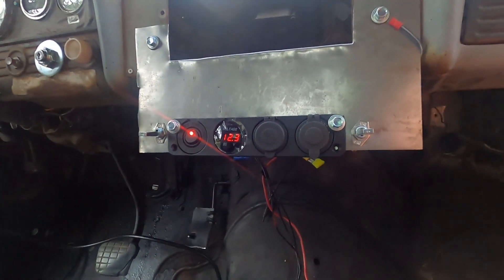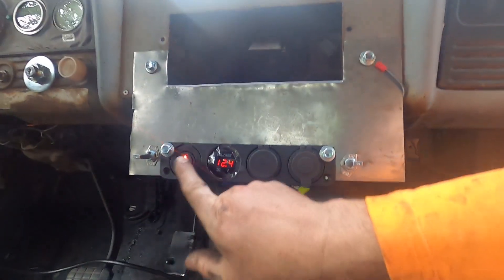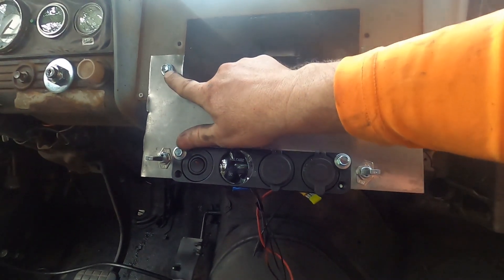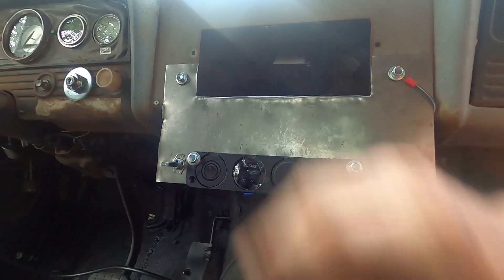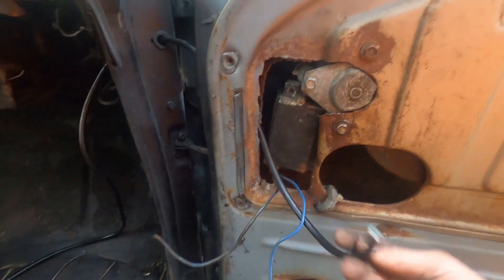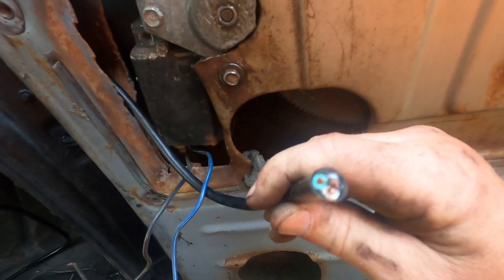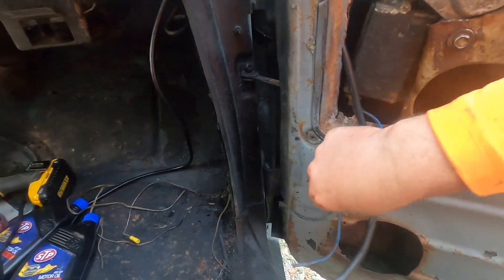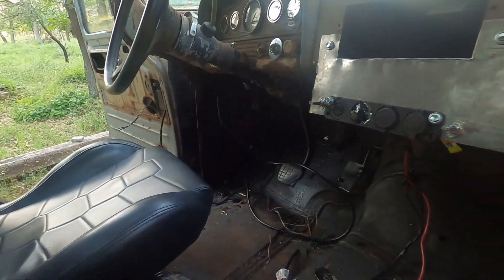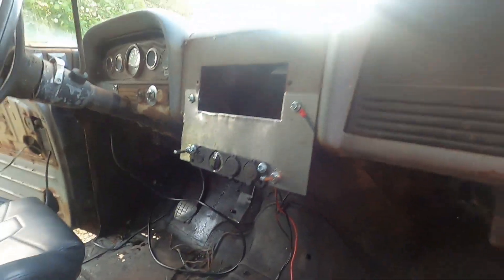You can see it sitting there powered up. I grounded it to the body. I'm going to put another ground through here to run both window motors, and I'm going to put the ground right here on this bolt. One of these three wires goes to that and the other two go to up and down. That's my plan — I'm going to get that going tomorrow most likely.